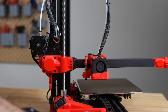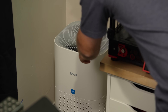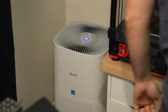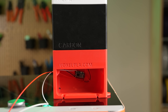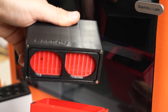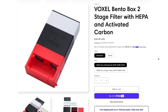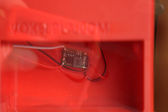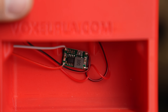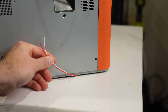Now it's time for some filtration. A huge percentage of what I print on the X1 Carbon is ABS or ASA, and with this printer being up in the studio where I work, it's something I wish I'd done much sooner. I did end up getting a HEPA filter for the entire room, but cycling the air inside of the printer before it leaves is even better. For this, we're using the Bento Box — a two-stage filter with HEPA and activated carbon that uses two fans to pull air through the tower. This is a project created by Through the Frame, and the parts can be printed and self-sourced. Voxel PLA also has the hardware and filters available, or a complete assembled unit, which is what I'm installing. The fans are 12 volts, so I installed a tiny 12-volt buck converter to step down the voltage from a 24-volt power supply. There's a groove on the bottom of the housing for alignment, and an M3 screw secures it to the bottom panel. I fed the two wires through the hole on the other side of the printer's base so I can tie them into the power supply.